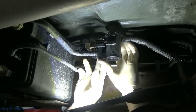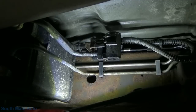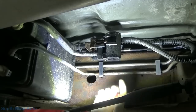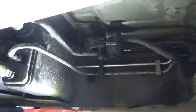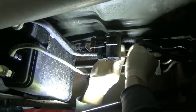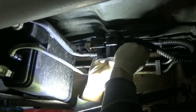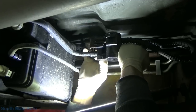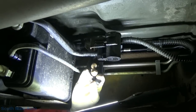This has got the new style connector on it, so I'm going to need a pocket screwdriver. GM has never been able to get this vent solenoid right - really high failure prone item. It has a red lock tab that you have to pull down first and then depress the release. Alright, part two - Eric gets the connector undone. Let's get a little scope on a rope.